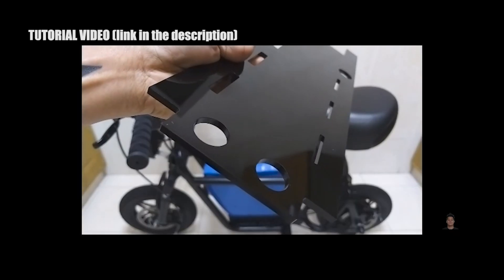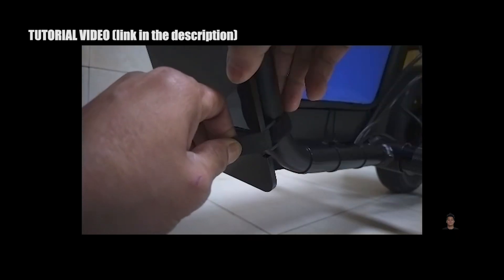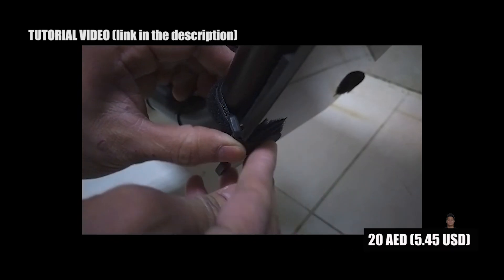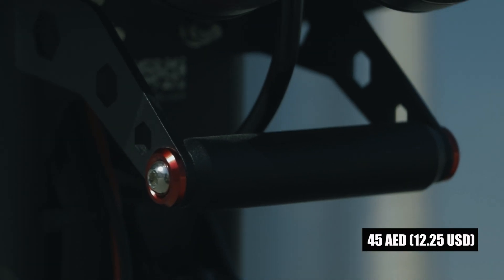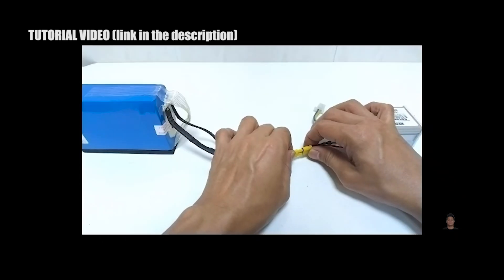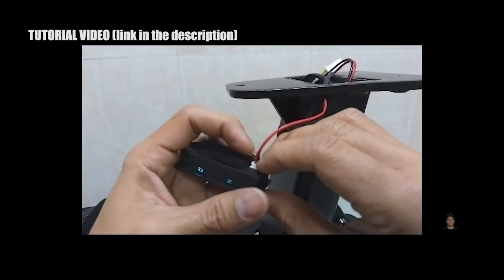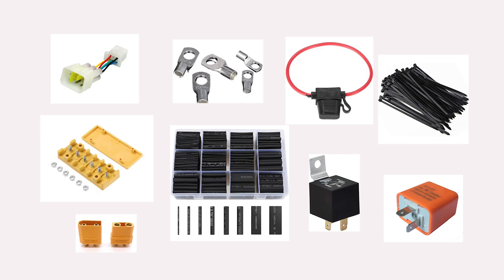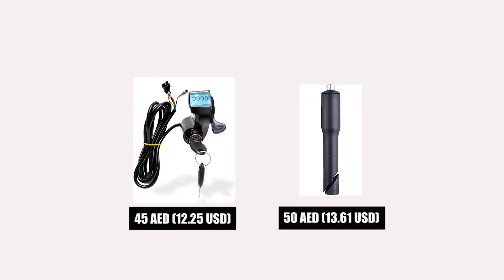I used an acrylic board to cover the huge battery pack, with reusable straps for fastening the acrylic board on the frame. I also added aluminum foot pegs and an aluminum grab bar. I installed a 12V output DC to DC step-down converter on the stock 36V battery pack to supply power for the lights and horn, plus a voltage meter display to monitor the stock 36V battery pack for the accessories. I also used connectors, heat shrinks, fuses, relay, and zip ties.